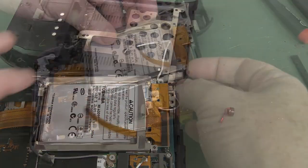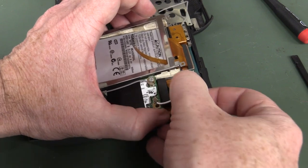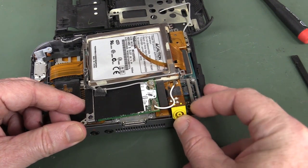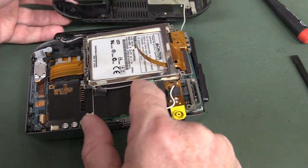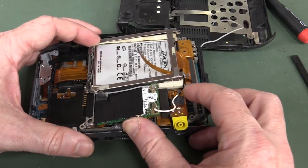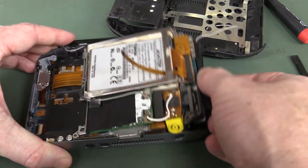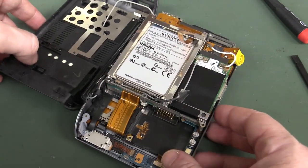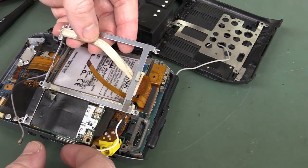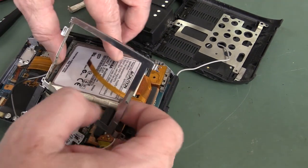I just tried to take out the hard drive bracket, and this whole thing looks very, very modular. That's obviously our Wi-Fi module there, and there's our Wi-Fi antenna cable up there. So we've got Bluetooth and Wi-Fi of course. It looks like this whole lot just might lift out — it's going to be very modular, but tightly packed. Nice fit-to-envelope design, that's for sure. Nothing wasted. And they've got a rubber surround on the hard drive here, stopping the noise and vibration — that's a really nice touch, and also impact protection because you're going to end up dropping this thing.